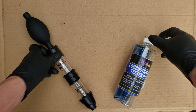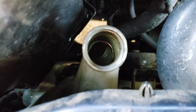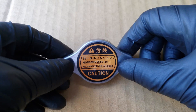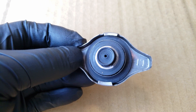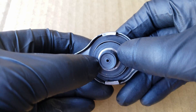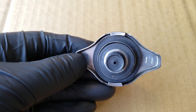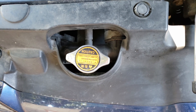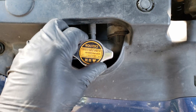The reason I am performing this test is that the vehicle has been overheating lately and it's been losing coolant through the overflow, which is normally associated with too much pressure in the cooling system. When this happens, the first thing you want to inspect is your radiator cap, looking for any damage to the rubber or broken or damaged springs. But this radiator cap is in good shape and holding pressure as it should. I've also made sure to bleed out any air in the system, which can also be a cause, but it still didn't help. So another possibility is that the combustion gases from the engine may be creating this excess pressure.